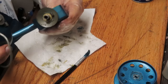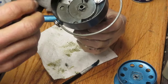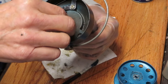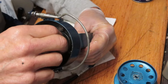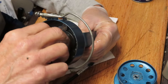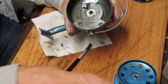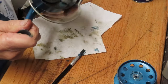Hold your pinion gear, make sure the shim is on there, and bring the rotor back in and on. Align the keyway so that it sits in the recess of the rotor. Remember, this came off in a reverse thread, so you're going to go counterclockwise — the old lefty-loosey to tighten it. The first time I saw this was on an early 1960s Chrysler that I owned. On one side of the vehicle they had reverse-threaded the lug nuts, and it drove me nuts — I couldn't figure out why I couldn't get the tire off.